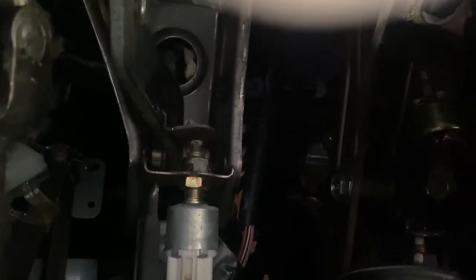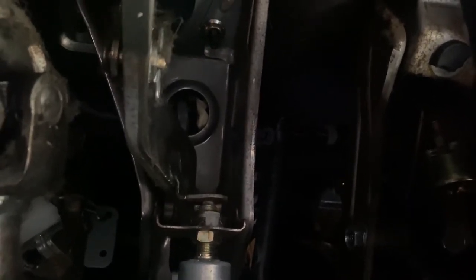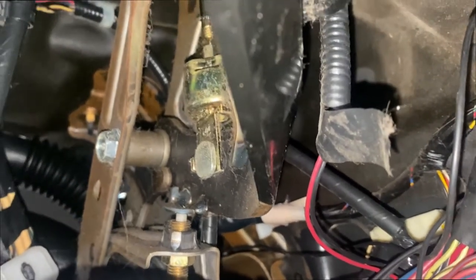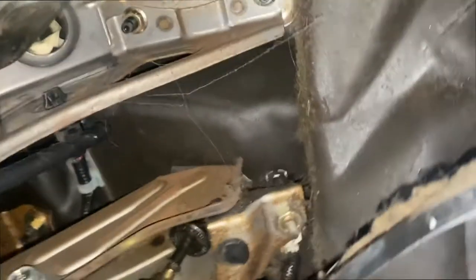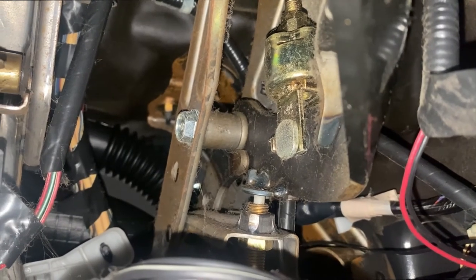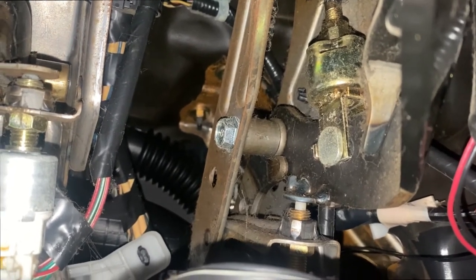Basically, this one right here is your brake. So this was working perfectly fine. When you have cruise control and you press the brake, it should disengage. Also, when you do the clutch, this one's the clutch right here, I had to turn on the light. This one's not really engaging when I put it back in. That bottom one over there is when you turn it on. So you press it off. And I think this one is, when you're on cruise control, if you put the clutch in, it will disengage it also. So it always thinks that the clutch is out. So that's probably why it's never engaging.